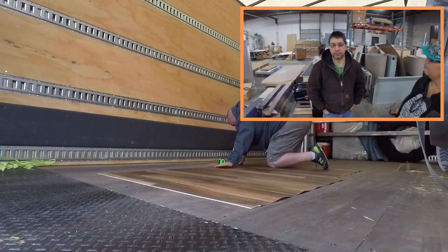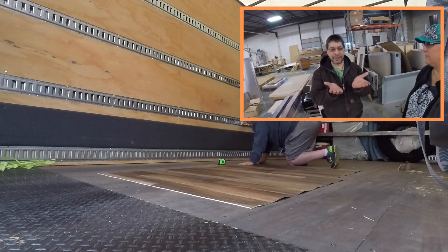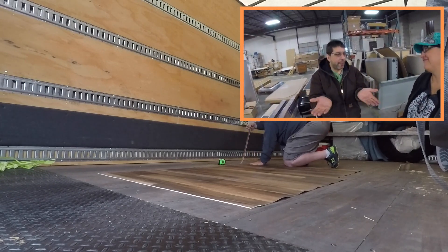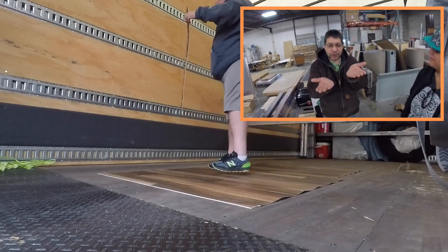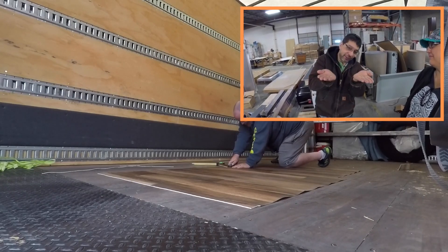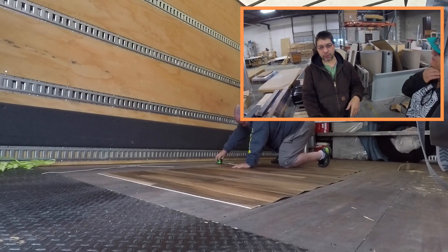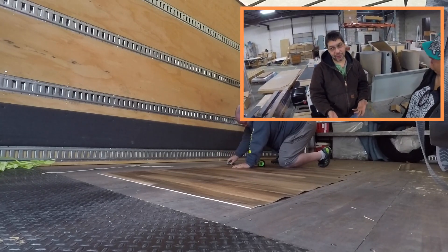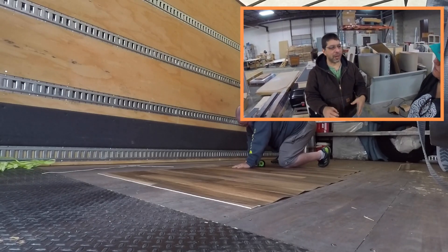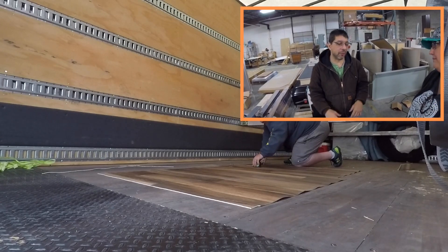That tells me ice caked up all over the freezer — somebody left the truck, it thawed out, and filled up those trays with nowhere to go but on the floor. The freezer drain tube might have been the problem because I blew it out and some stuff came out. It's just a little plastic tray at about a six-degree angle, and if your truck is tilted, water won't go out the tube — it'll go out the front. We fight ourselves on giving an honest opinion, and sometimes that honest opinion is we kind of screwed that up. But if we do it, we own it.